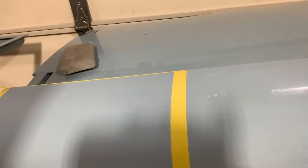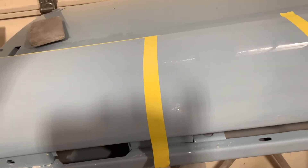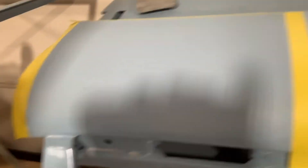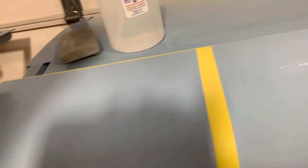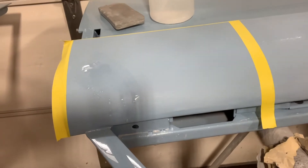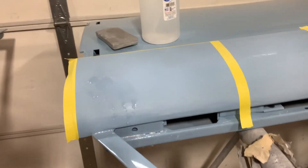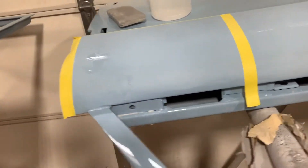It'll be super smooth and actually start polishing with the sandpaper. I do all this with wet paper — a hard block to start, then I go to a soft block. As I'm wet sanding I want to make sure my paper stays wet. Dip it in clean water, make sure you don't have any grit on it. I'm also using a sprayer to spray water on it, which helps glide the paper across and keeps trash out.